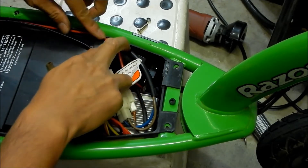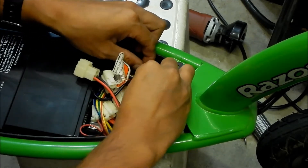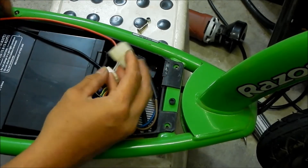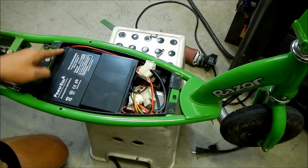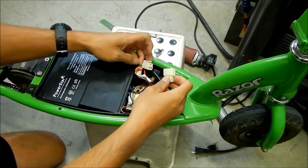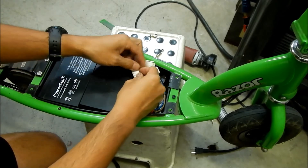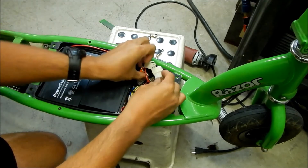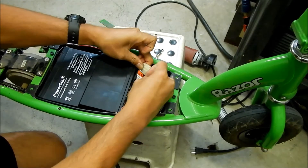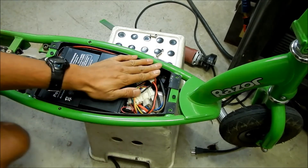Just try to keep the wires relatively neat. Plug this in — hopefully it does not explode. For the final one, just make sure all the wires are in this little channel so they're not gonna get pinched when you put the cover back on. I'm gonna roll up the excess and stuff it in there, then plug this in right here. At this point you can probably test the scooter out.